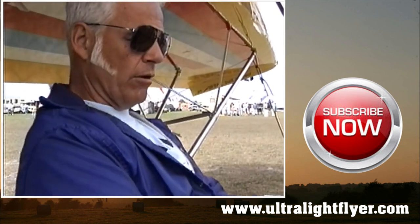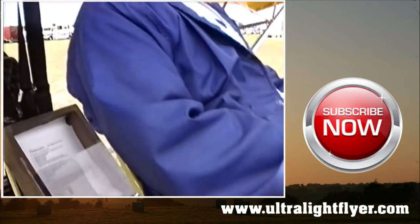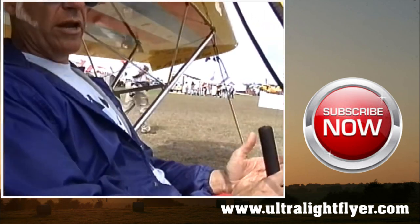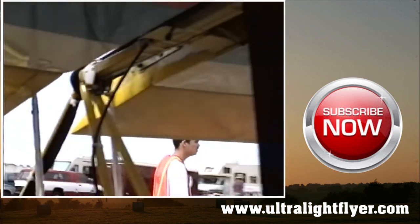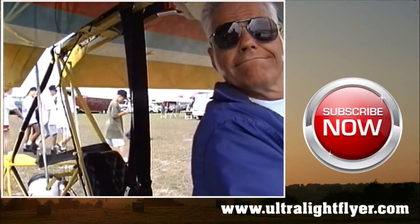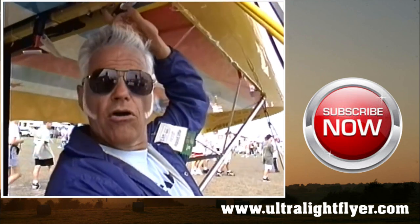The control system is a very smooth system, similar to our standard Air Bike — very light controls. Are we using Teleflex or push-pull? Yes, Teleflex. We have full-span ailerons, but we also have full-span flapperons. For a training airplane, we have a switch panel up here — if you want flaps, you simply push the button and the flaps go up or go down. And you still have full aileron deflection at full flap. That is a lot of flap. But it is a training aircraft, so they did decide to go with flaps.